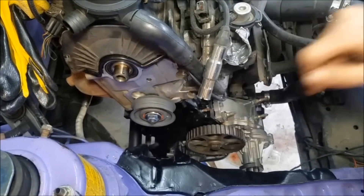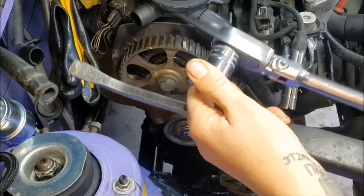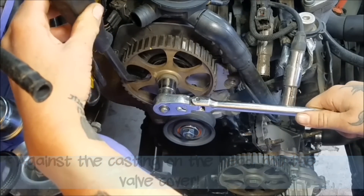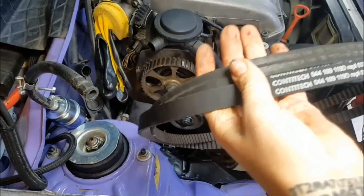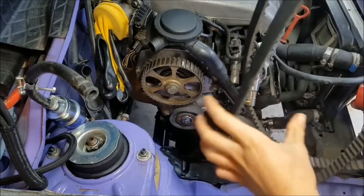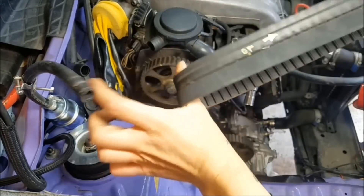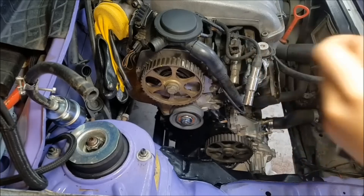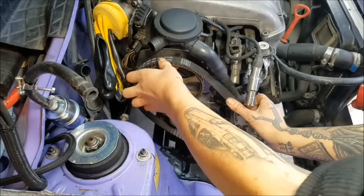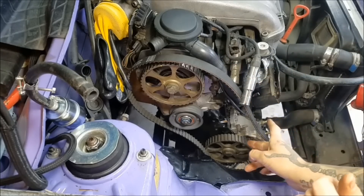I replaced my cam seal. Now that the cam pulley is on, in order to tighten it I just used my 19 millimeter socket on my ratchet, held the pulley in place, and tightened it. Before I put the belt on, I'm always going to compare new and old. They make it super easy because the part number is the same and it shows it replaces the same part. I'm also going to verify the width and length are the same — just so if something goes wrong I know the belt is not the cause.